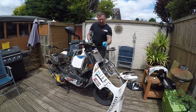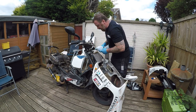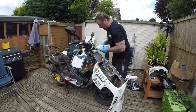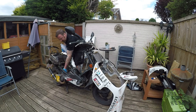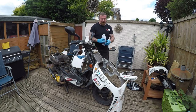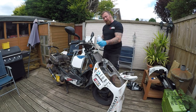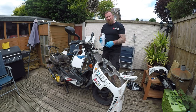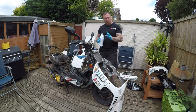Really, really good — going to pop some water in now. Ordinary blue ready-mix coolant. I've blown through it. Fill the whole radiator up with just ready-mix. Squeeze the pipes to make sure you get it all through. Then run the bike with the cap off — that gets rid of any bubbles. Once it's warm, put the cap on, job done. Go for a nice little ride, check it in 10-20 miles, make sure it's still topped to the line — not completely up. Happy days, no problems at all.